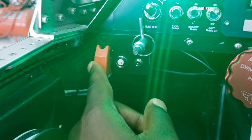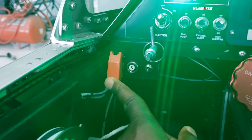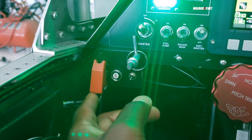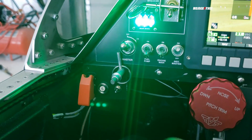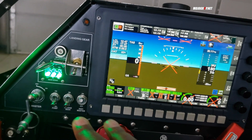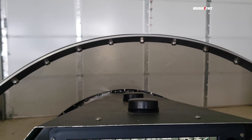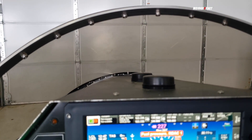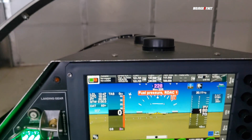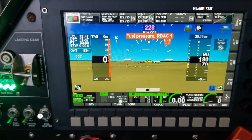This big red thing you see here is the emergency power-off switch. If something goes wrong, you pull the cover off and hit that to shut everything off. Right now the avionics are running off the two front batteries — I believe they're 12 volts each. But once you start the engine in the back, those batteries become backup and the engine power drives all the electronics.